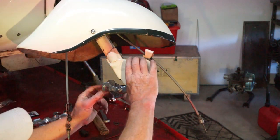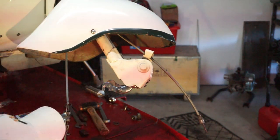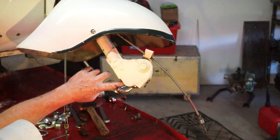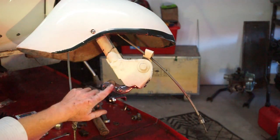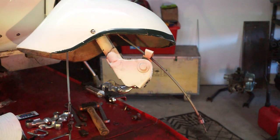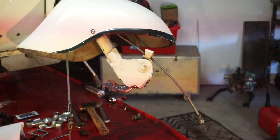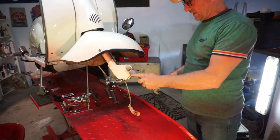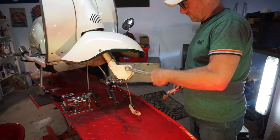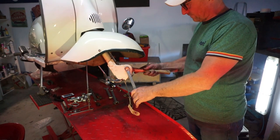And we've took a lot of tension already off the spring. So now we should be able to get our tool in to remove it, to take the tension up, and then we can get the buffer out, if we can get these bolts out, which have been painted over. So they're going to be fun. Okay, we've took the nut off, that's fairly free. We're going to just use a copper hammer on the back.